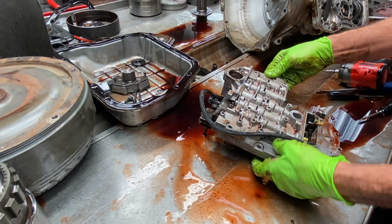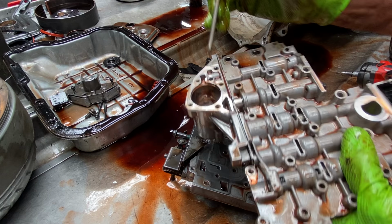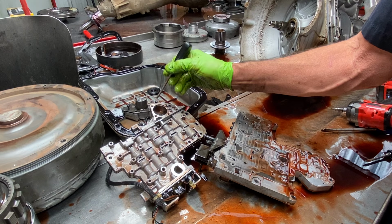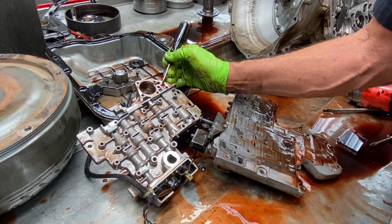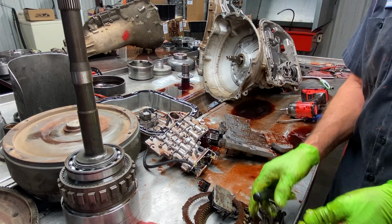Now you can see this little bushing right here that's been installed. This has a new Transgo plate here. There are some modifications you have to do. You can see a hole here where they drilled all the way through. Now this new updated shift kit that I got, you don't have to drill this anymore. You just plug it here. The new top hat that comes here physically has a hole in it for the drain. See, it sets on here like that. There's a hole in the middle now. Before, they were draining the fluid out the side right here, so that when the piston came up, it didn't try to catch the fluid on this surface here and collapse it inside the piston. That way the piston would move freely. So that's one step that you don't have to do.